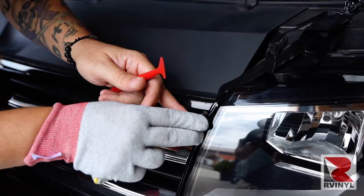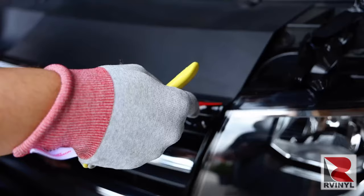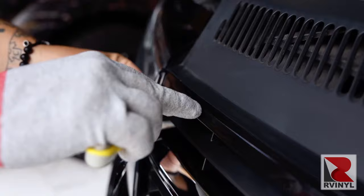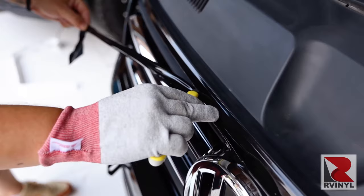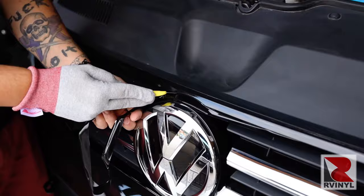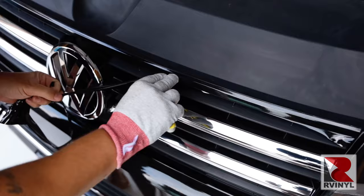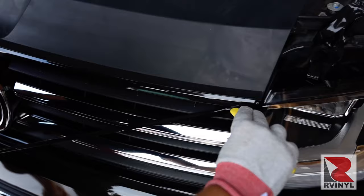At the very bottom, make sure you cut away from the vehicle to avoid cutting the bottom section of the grille, then use the tucking tool to seal the top edge. For the bottom section which is open, use the free hand to pull the material away while cutting in the opposite direction — this will help ensure a straight cut. For the curved section above the emblem, keep the blade low and flat, pull the excess film away, and before going to the opposite side always make sure you seal the deal. Once that side is done, again pull away and cut in the opposite direction, then run a finger to seal the deal.